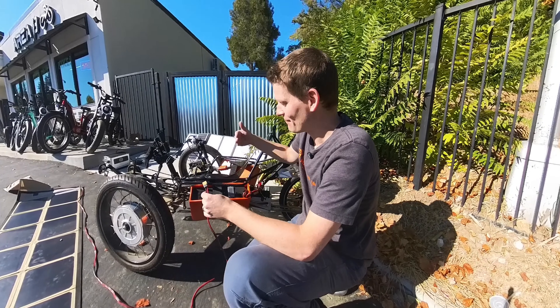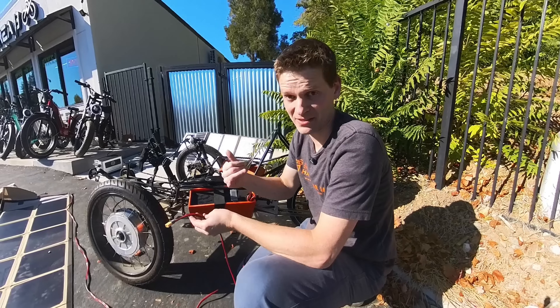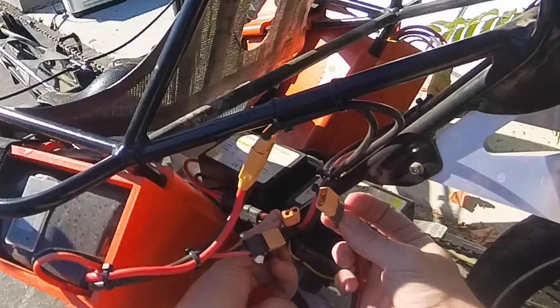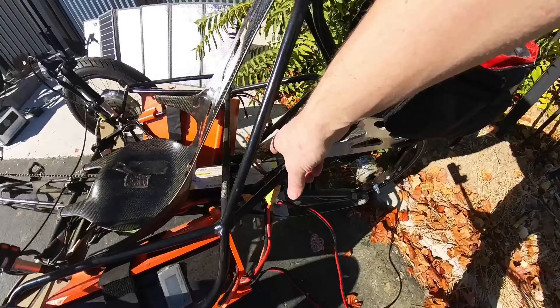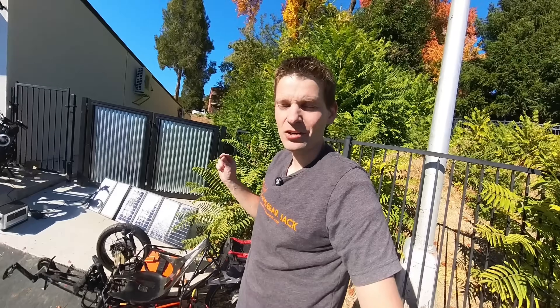So if I had a 48-volt bike, I would have to buy another charge controller for that bike. If I had a 52-volt bike, I'd have to buy another charge controller for that bike. You can see how this would get very expensive, very fast. Using a setup like the EagroTech system, you don't have to do that. So I'm going to unplug my little cap right here so I can plug this panel right in here, and that is going directly to this charge controller. Takes a minute to kind of wake up. Now I have a little light blinking every once in a while — it is awake. So just to recap: I'm going from solar panel to charge controller directly to battery, DC through the entire range.